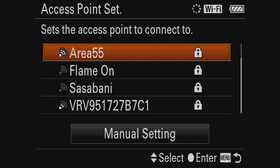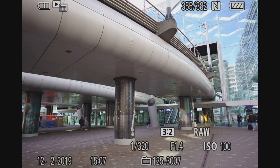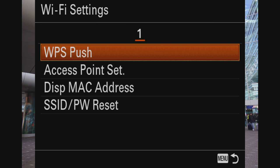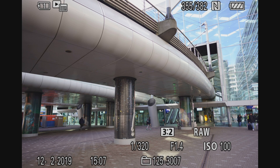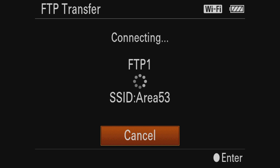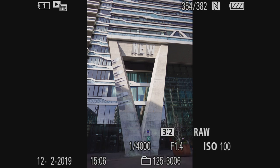I'm not sure if it will show my password, but let's see what happens if I press on manual settings. This is just your sort of setting up your Wi-Fi, so you should be able to handle that and set up your Wi-Fi access point. So hopefully that will work. And you saw that in the first step — if during the FTP first step you can't get it to work, then I hope that makes sense. So if you have the Wi-Fi connection up and running, you should see that if you select a picture and transfer it, that step would at least work, because then it should connect to your FTP server. Otherwise it would say can't find the FTP server. And if you make it to this screen — connecting to Wi-Fi, connecting to the FTP — you already know that you've reached your FTP server.